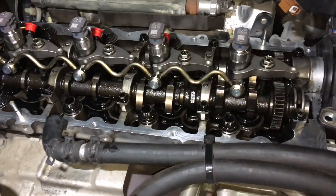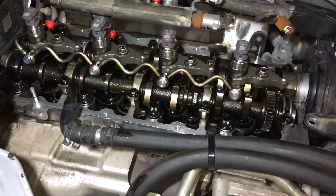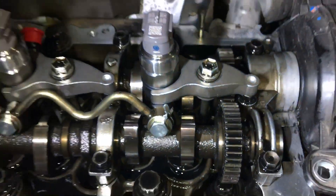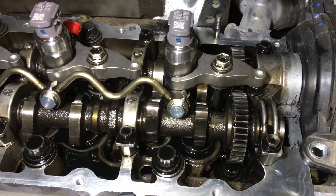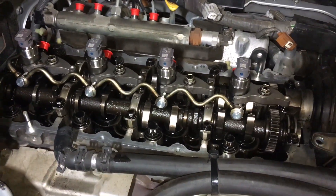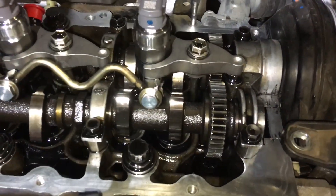New injectors in, new clamps. We upgraded — see the little bolt right there in the return line? On older engines they were 17mm head, and they tend to grab the little gaskets and twist them. So we do what I call an upgrade and put the later model bolts — from about 2010-11 onwards — these small 12mm heads that don't seem to grab and twist those little things. Sometimes you get lucky, sometimes they just twist anyway.